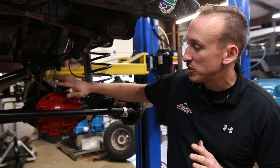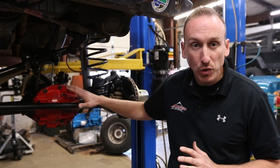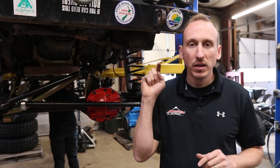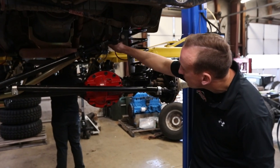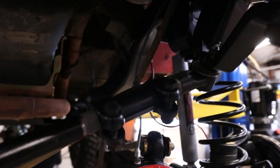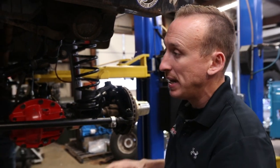There are a lot of different lockers. This particular Jeep has an air-actuated locker, and what that means is at the push of a button, on demand, we have a switch inside that sends air through this little blue line to this locker. What that does is it makes both tires on the axle — left and right — spin at the exact same time. Traditionally, I'll only use a locker off-road when I'm stuck in a real predicament, with an obstacle to get over or some real nasty mud. I'll engage that locker and it'll give me all the traction I need to make sure I don't get stuck.